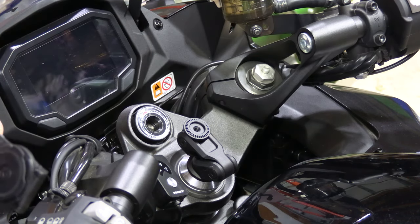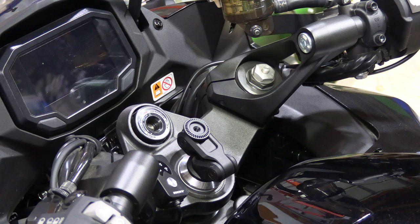I do recommend putting a vibration dampener on here. If you don't, your phone's cameras can get ruined — iPhones especially. No matter what, do not run your camera even with the vibration dampener, because your camera has image stabilization and it's going to continue trying to stabilize a vibrating phone, which will ruin the image stabilization. So don't do that. Now that that's done, I'm going to go ahead and install my vibration dampener and my wireless charging head.